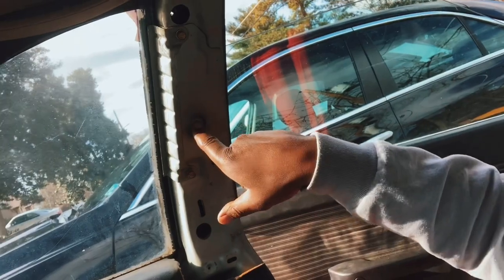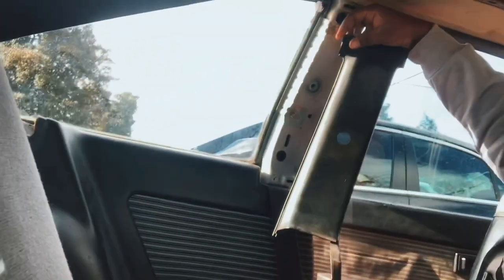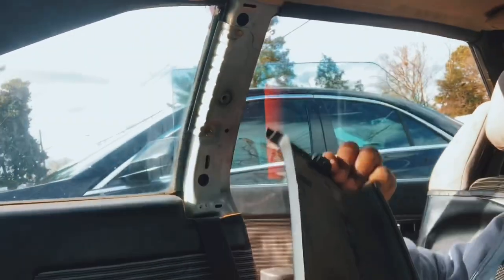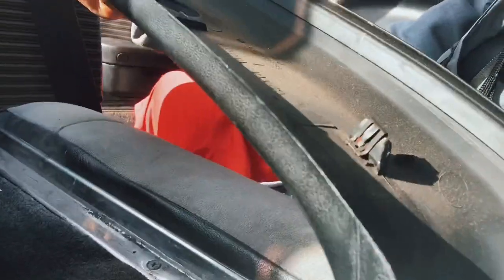So the end result — you see here — you keep that in, you don't have to take that out. You pull out the plastic piece here. The 14 millimeter bolt goes through there. Once that comes out, this trim piece here comes off — as you can see, it takes a little bit of prying and you have to be careful because these plastic tabs hold it in, and there's a little metal clip. Use a plastic molding removal tool.